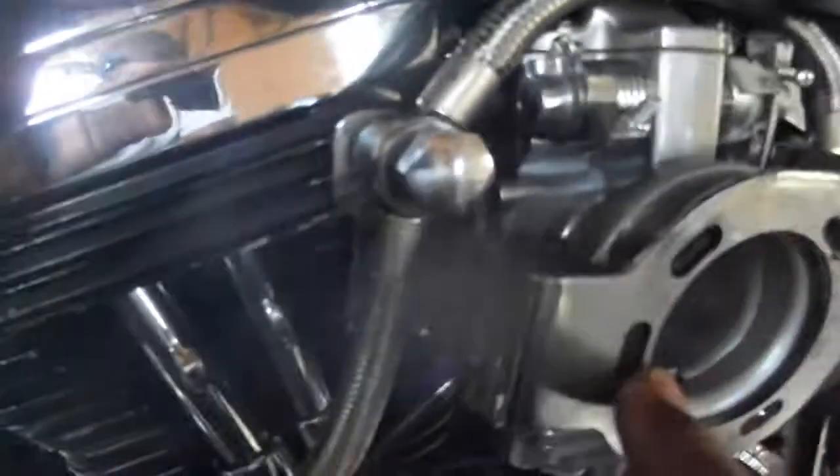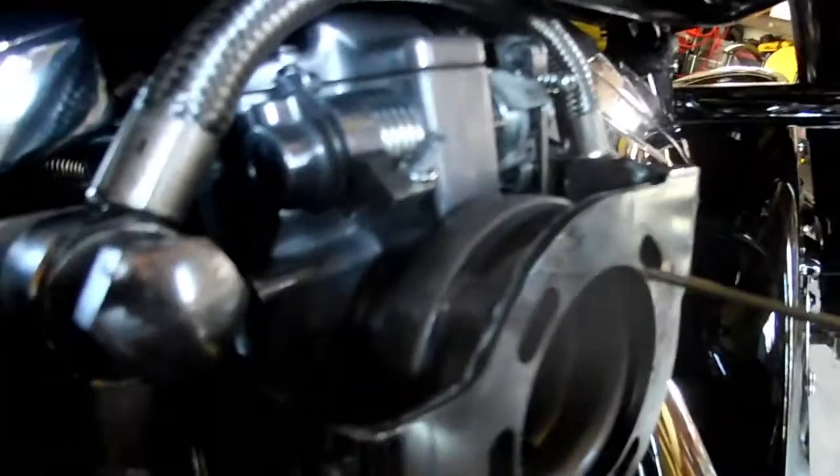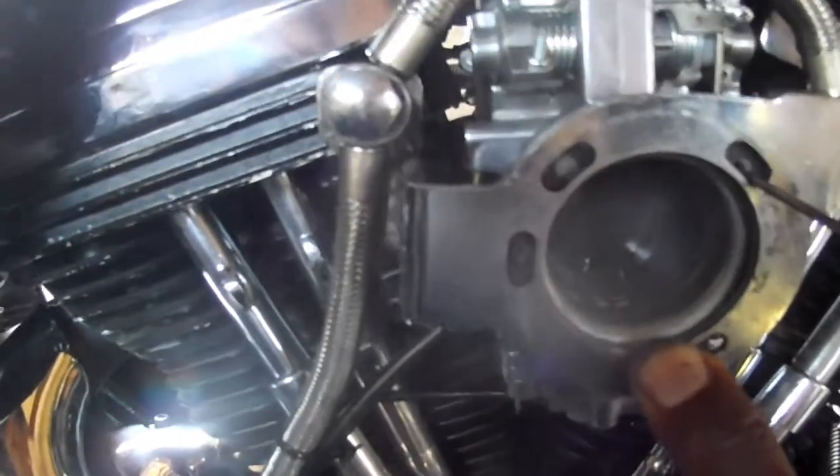The part I need is this bracket for a 48 millimeter Mikuni carburetor. So what I did is I went and cut it right here — see that? I cut that right there and I put half an inch — that's how much more I needed — in between it, on both sides together, which made this longer. And now guys, look at it. That's perfect. It's gonna hold that carburetor right up there in place, and look how much more thread I've got to screw down in there.